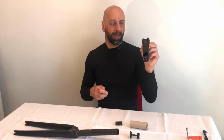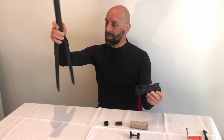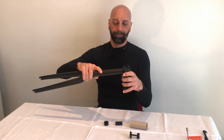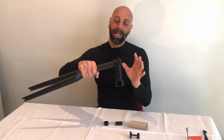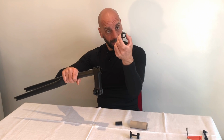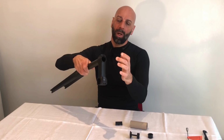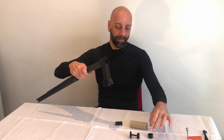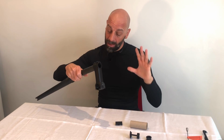If you do have the normal stem combination, I have to say it is safer, in my opinion, to run a spacer on top of the stem, because again you will clamp the steerer in a much better position if you don't have the insert. If you want to run a flush top cap where you do have a few millimeters of space between the steerer tube and the top of the stem, I would say the reinforcement element is highly recommended.